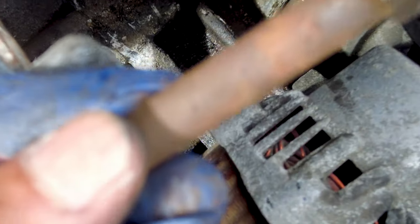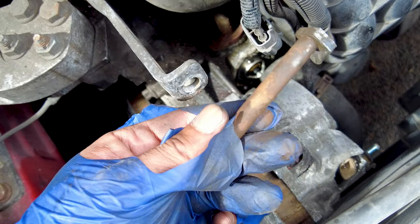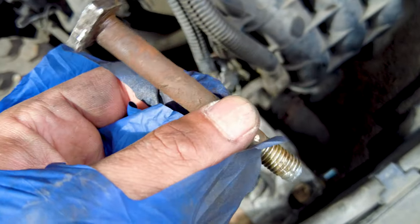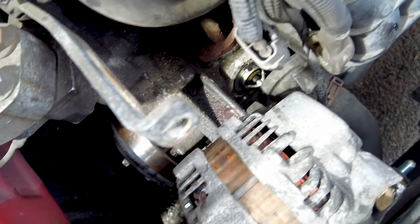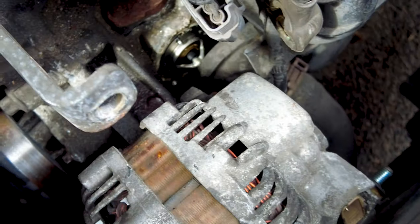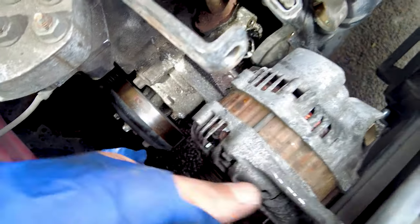As you can see, I had to disconnect that coolant pipe because it's actually blocking this bolt right here, which is the last bolt. There was loads of hammering on it — as you can see, that's in a bad state, so I'm going to be mending that as well when we put it back together. I had to disconnect it, but luckily the thermostat is blocking all the coolant from leaking out. Anyway, this is out now.